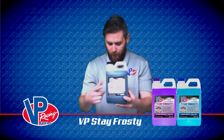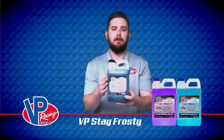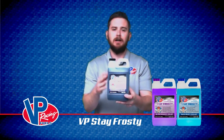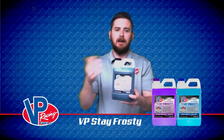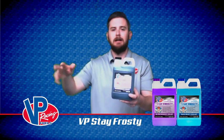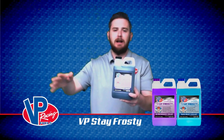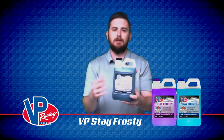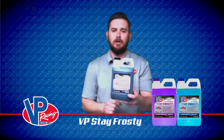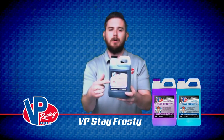I'll get into the high performance formula first. So what we did here is we added propylene glycol to this mixture. We've got multiple surfactants, also known as wetting agents. So that helps break the surface tension in a coolant system, improving heat transfer, getting that heat spread out evenly in your coolant system, thus reducing cylinder head temperatures and overall operating temperatures in general. Our claim is 25 degrees at the cylinder head on this product.